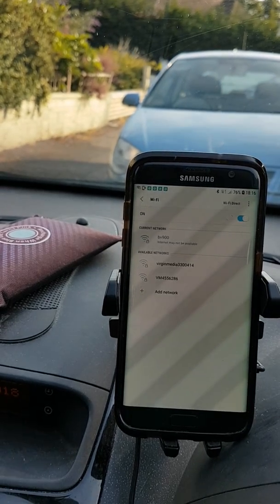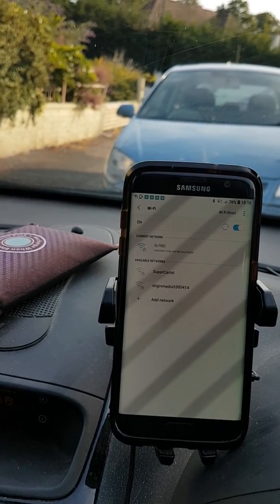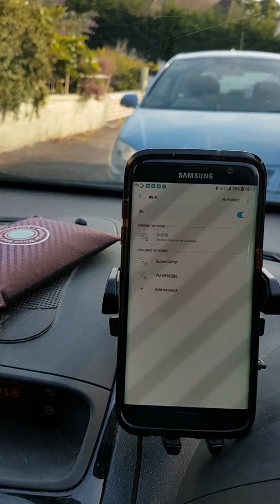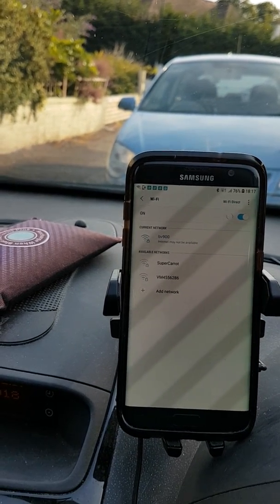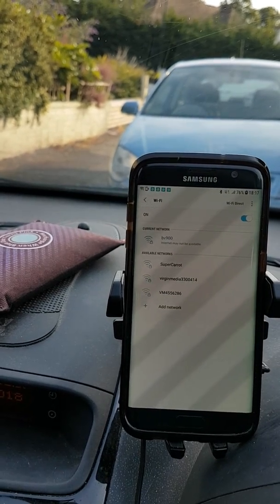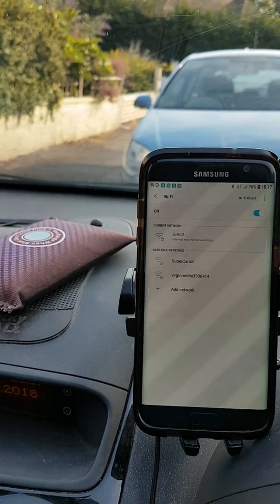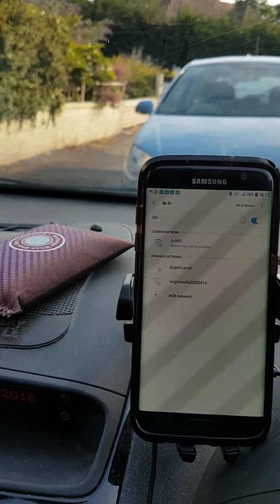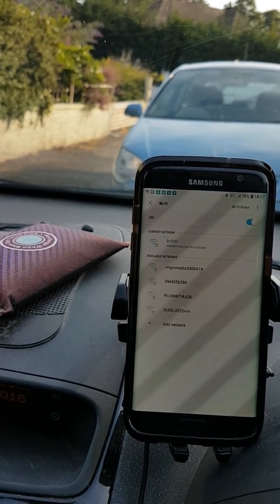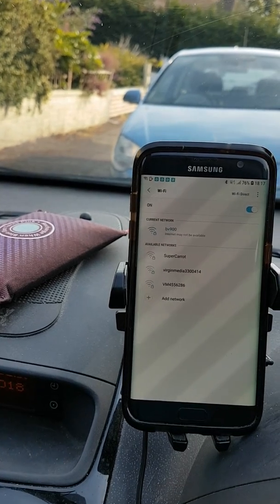Many other phones that have been mentioned both in the comments to my previous videos or in the dash cam talk forum thread I've got going on this - they've all stated that the workaround works, their phones are capable of seeing 5 gigahertz, and their phones do see 5 gigahertz if the dash cam is connected to a 5 gigahertz hotspot first. For some reason it's broadcasting on a channel that most devices can't see. It's not the fact that devices can't see a 5 gigahertz channel - it's that they can't see the specific 5 gigahertz channel BlackVue has defaulted to. So praise BlackVue for half sorting it, but I want 5 gigahertz because I want to use the live camera view and need that bandwidth. Well done for getting it half sorted BlackVue - now can we have the 5 gigahertz on a more respectable channel please? And thank you for watching folks.